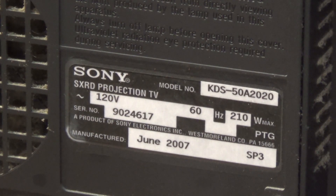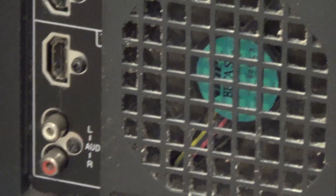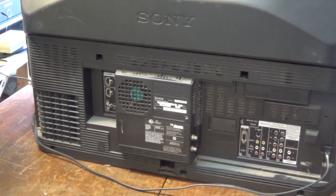It does use a mercury lamp as its projection light source, so it may be just that the lamp has failed. I can feel that the fan is running — you can probably see it spinning in there — but we have no light. It may be that the lamp has failed, or it may be something more serious. I'm not going to buy a lamp for this set, but I do have a couple of old lamps from other sets that I might be able to make work if it is just the lamp.